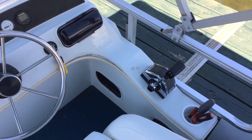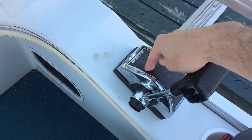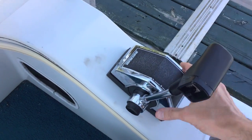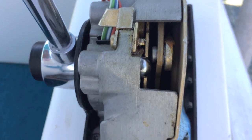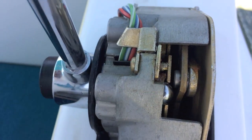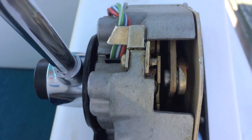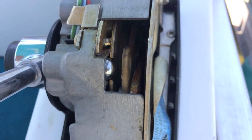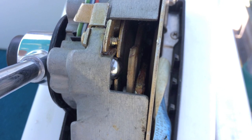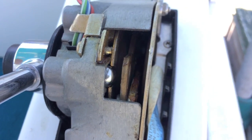Today's a fun video — we are going to replace the shift cable and run you through the step-by-step. If you've got the same throttle mount, there's a mounting screw here and you will be able to shift this cap off. Inside, this little spring-loaded ball goes in and then into the next detent — forward, neutral, and reverse detent. The problem is it's not actually putting the linkage into gear in the reverse stage, so we are going to replace this whole cable.